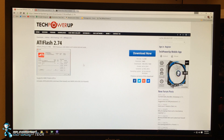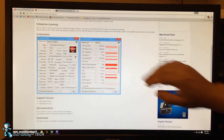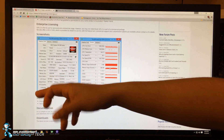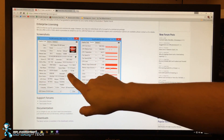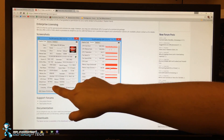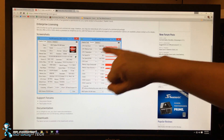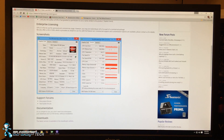First off, you're going to need ATI Flash 2.74 — we'll put a link to that in the description below. You'll also need GPU-Z to monitor the card you're using, specifically for memory size. You can see all the other settings with it — bus width, bandwidth, memory speed, capacity — and you can use it to monitor usage of each: the core, memory clock, temperature, all of that stuff. You'll need it to basically make sure the flash worked.